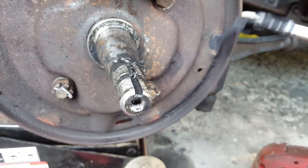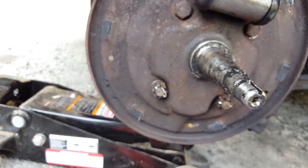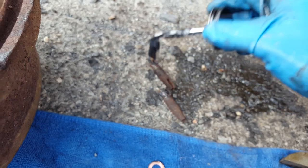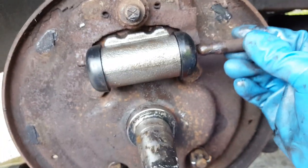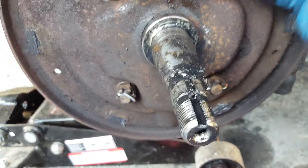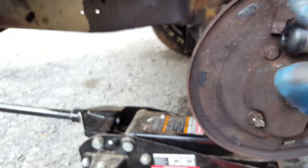On these little spots here you can see where the brake shoe rests. Just put some grease on there — any time you have anything moving or any friction you want to grease it. I'm also going to do the tips of these. Use them and you want the slots facing upwards. Just jam that in there, same thing with the other one.